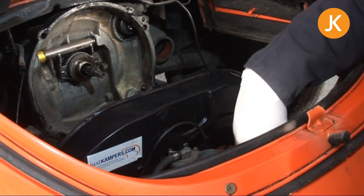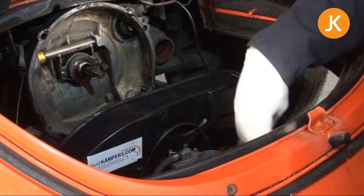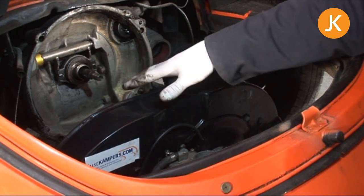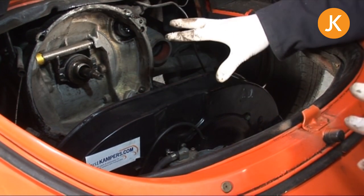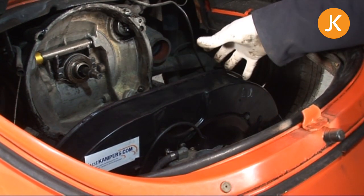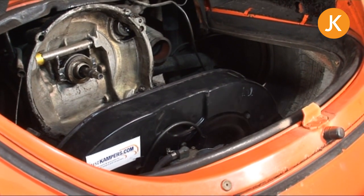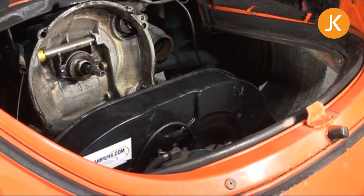What we're aiming to do is get the crankcase half — that's the line that goes approximately underneath the carburettor in line with the input shaft once it's on the trolley jack. At the moment it's too far over to the right, so we need to push it a little bit to the left of the engine bay. Now a couple of really important things to remember here: the safety we've already mentioned, getting a friend ready, but there's one little technical thing we need to remember.